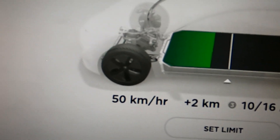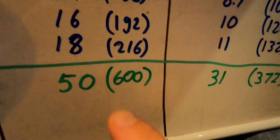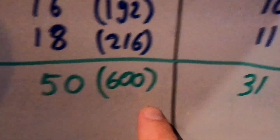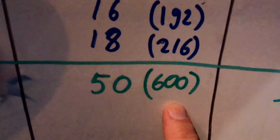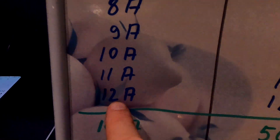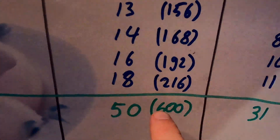50 kilometers per hour! So if you can hook up your Tesla wall connector or other charging station to 10-amp three-phase, you will get 50 kilometers per hour, which is 600 kilometers overnight in 12 hours, or 372 miles overnight. That is insane - this is more capacity than the battery actually has. So I could fully recharge this car overnight on 10-amp three-phase with this wall connector.